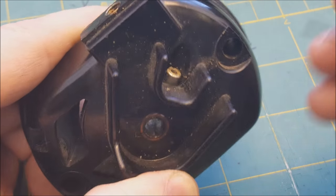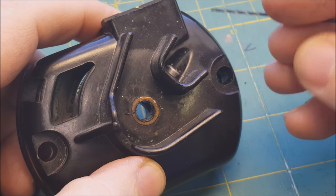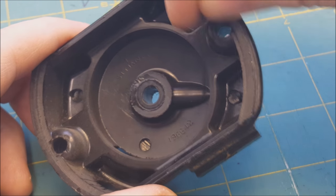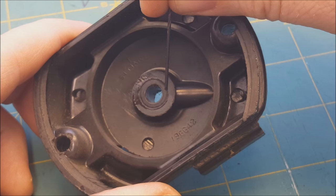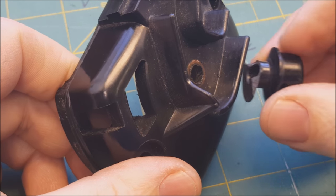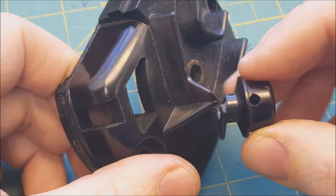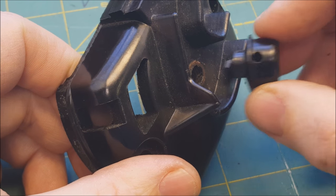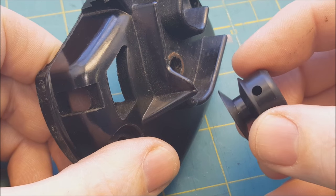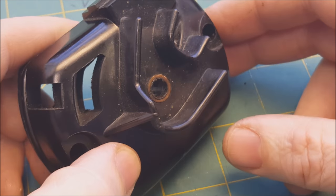There are a couple of things to remember. Number one, we're only a half inch long here, so there's not going to be a lot of room to get lubricant in there in the first place. I took this motor apart so you could see where this goes — you can see the angle of this lube port, and it goes right up into this bronze bushing. One downside of this is you have to disassemble the armature, which means taking off the pulley that the belt goes on. And these things are brittle and they break. Sure enough, I was trying to get it off and it snapped. But fortunately, just the other day we had a reproduction made, because prior to that you had to try to use a metal pulley with a different screw, and it didn't quite work right. So there is an alternative if you have to get to that point and you break it — no major worries now.